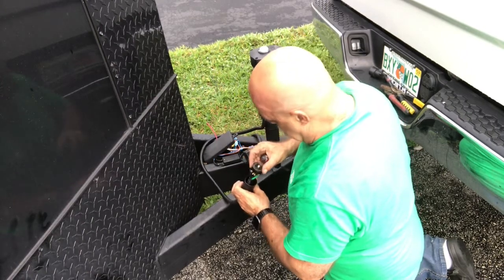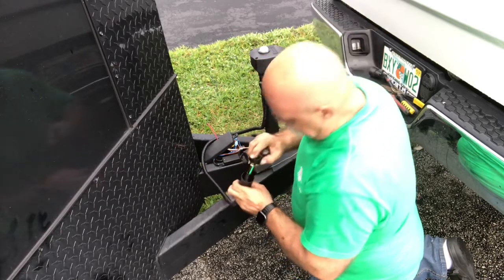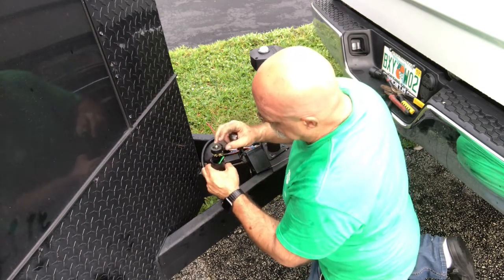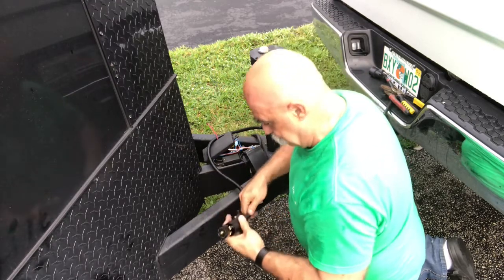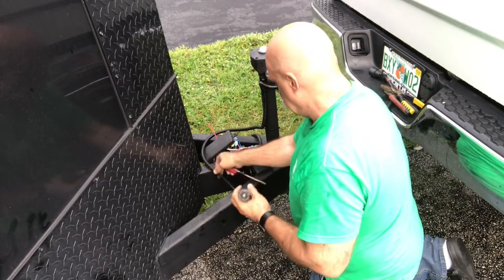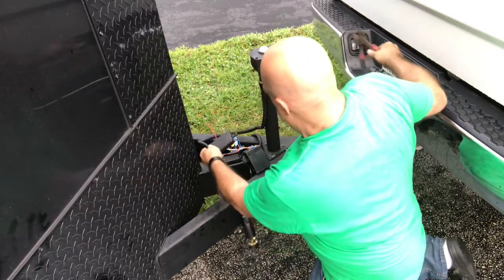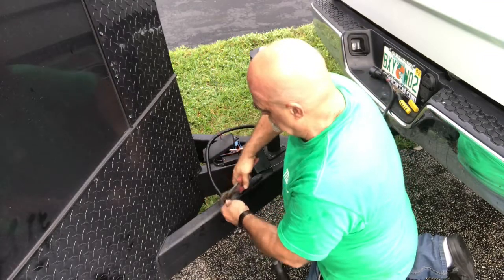So we know hot was black. Okay, see, it has a groove to where that was in the top pin. All right, and so this is hot, which is black, and this yellow-green is the neutral. So now that we know the black is definitely hot, it's what I would have assumed, but we don't like to assume. So I know I have enough wire to get into this box. So I'm just going to go ahead and cut it.